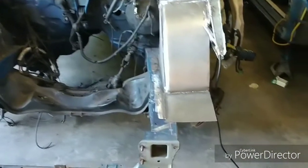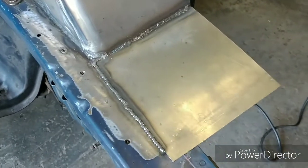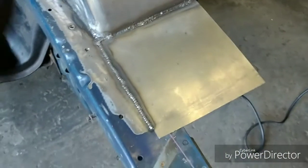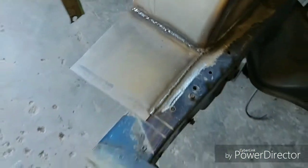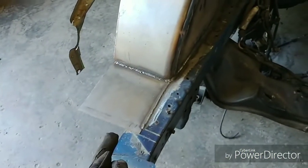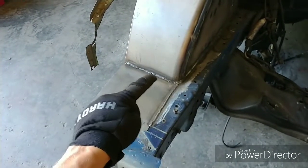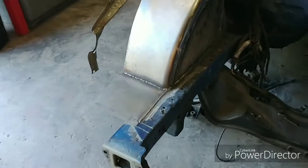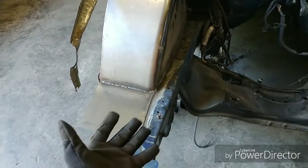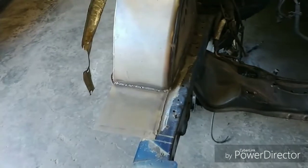As you can see, I've got the bottom pans all welded in — just went ahead and tacked it all in. You work yourself, basically tack in your spots and then weld into those tacks after. You're going to want to weld the top side and bottom side as well. You want guaranteed penetration all the way around so that when you grind this down nice and smooth, you have a backer weld. You know it's solid and you know there is an adequate mill thickness of the steel — and that's what you're looking for.